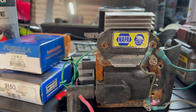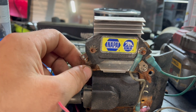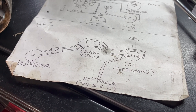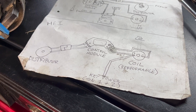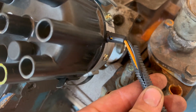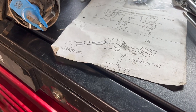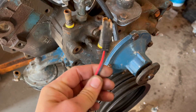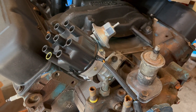So for this reason, I use care when I'm wiring the distributor side. I do like to use a smaller spade on the G terminal so it can't be reversed later. But before I finalize them, I set the wires in, pull them tight, and test-fire the vehicle to make sure it's good. This diagram is a rough copy of one I've referred to on the internet dozens and dozens of times. I could swear on that diagram it is drawn backwards, because I've tried to match it time and time again and it's always wrong. I think orange goes to white and black goes to green — so that's probably backwards. It may even be different based on the rotation direction of the distributor. Just assume you're going to get this wrong on your first try and you'll be good to go. You can just clip the wires going into the distributor and hardwire them, or you can find this pigtail end at your local parts store to match the factory Chrysler distributor end — that's nice in case you ever experience a distributor failure, and because that's not entirely uncommon, I always do this.